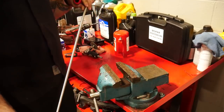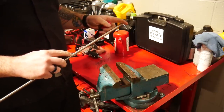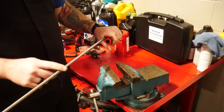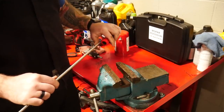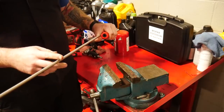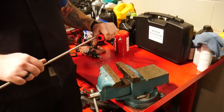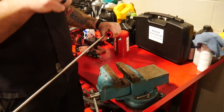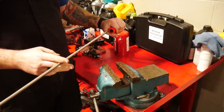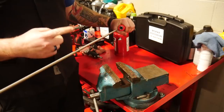With the piece of stainless I ended up getting, it's about 36 inches long. The rods on the Snap-on kit are only about six to nine inches outside of the handle. For the larger handle, I'd actually like to have a curved piece — something the Snap-on kit does not have. Having a curved end will let me get through the firewall and around the brake booster, and when working underneath the dash it'll curve around to exactly where I need it in the engine bay. We'll cut this roughly in half, put a little curve on it, and cut the tip at about a 45-degree angle.